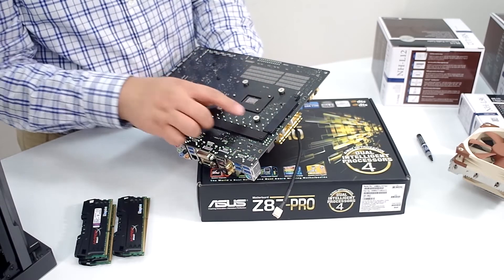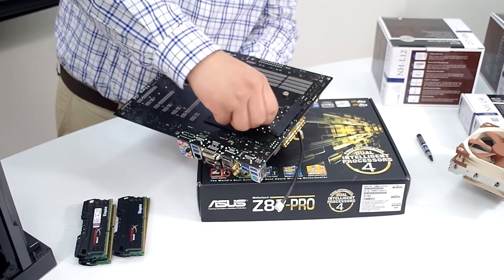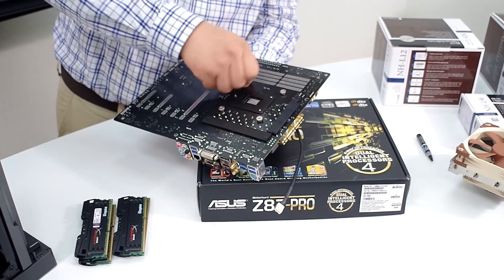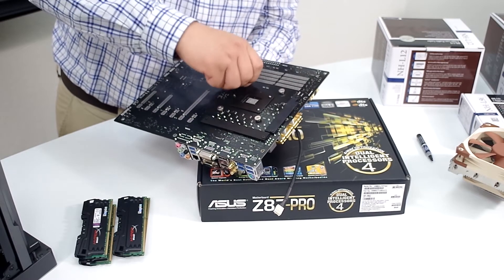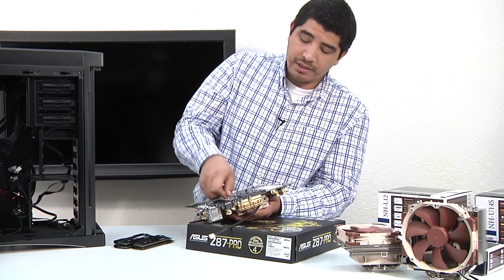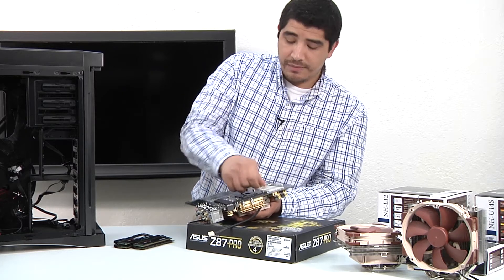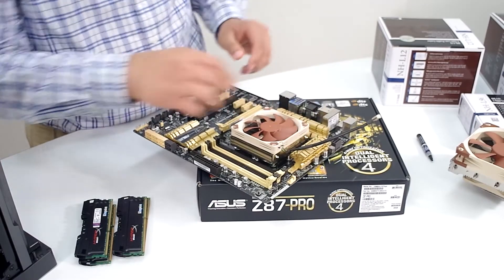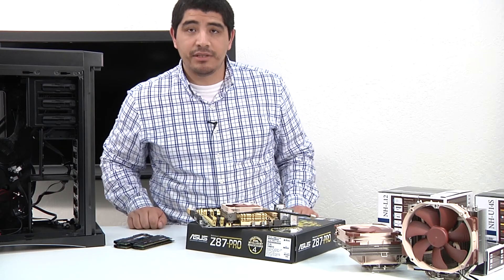There are very fine traces all along the motherboard and we don't want to compromise or damage those traces, so that's something to keep in mind. Once you've finished tightening these up, you're pretty much good to go. You can check the contact by giving a little pull on the top of the heat sink and making sure it feels secure and tight. If you want to take a screwdriver and apply a very minute turn, you can do that — but in most situations just follow the directions for your cooling design and backplate mechanism. We can see right there — a lift, no movement, no play. Everything is very solid and clean. We've now successfully installed the cooling solution.